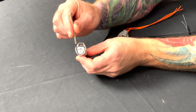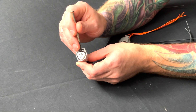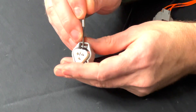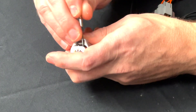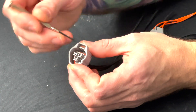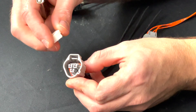Y210b3 — same deal, right? So you've got your gray outer shell, white interface, so that's your secondary lock. Just lift up, that pops up. For these, I just remove them all the way off — try not to shoot it across the room. And then just like the video, for these you slide down to that catch, lift it up, and then you just remove your wires.